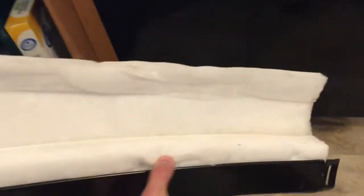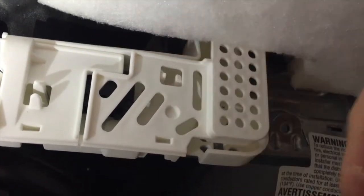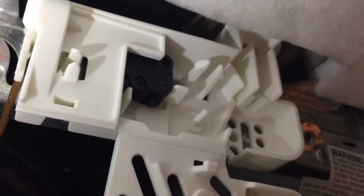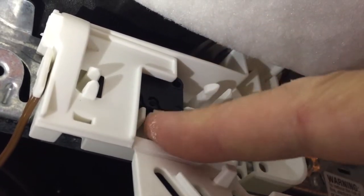On this particular dishwasher, after you take that piece off, this piece comes out with all the dampening stuff in it — which is frustrating because I have to re-situate that when I put it back, and also because it gets soaked and it's really gross. Down on the right side, right up under there, there's this contraption — we need to open it. There are these little clips right there; just pinch them together and pull this out. This little door swings open.